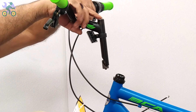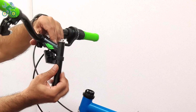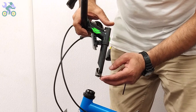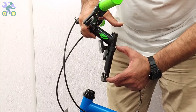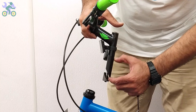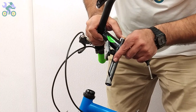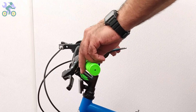Place your finger on the stem bolt and insert it into the head tube. If it doesn't fit, loosen the stem bolt a little and try again. In rare cases the hole may not align properly — if this happens, use an iron file to slightly open the head tube. The handlebar height can be adjusted; you can increase the height by up to half the length of the stem rod. Look for a specific mark or color on the bar indicating the maximum height — for safety, the mark on the rod must remain inside the tube. Align the tire with the handlebar and tighten the screw on the stem to secure it in place.